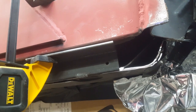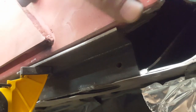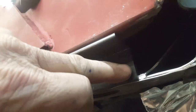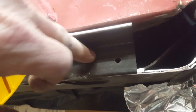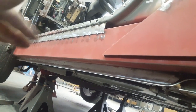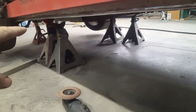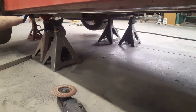I just want to show you how this cut-off angle is going to help close all this out. You can see it's going to tie all this bottom in pretty substantially, and it's going to tie into the frame rail up here, giving you a nice structural mend between the frame rail and the parts I cut out here - reintroducing strength to this area. Using this means it'll be substantial enough that you could jack along the entire pinch weld. These cars are notorious for having only a couple of locations where you can jack - there's a little triple-thick pinch weld.